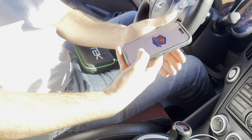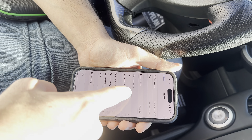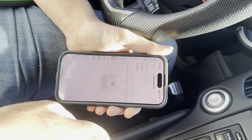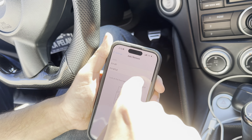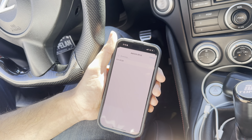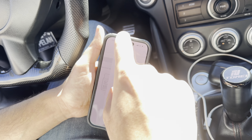You're going to click on the settings icon — it's a little gear right here. Then you're going to go to vehicle interface. Make sure your Bluetooth is turned on first. Click add/remove. All these newer devices are going to be the BTLE device, so you select that, then you click add. It picks it up. Now you back out of it.